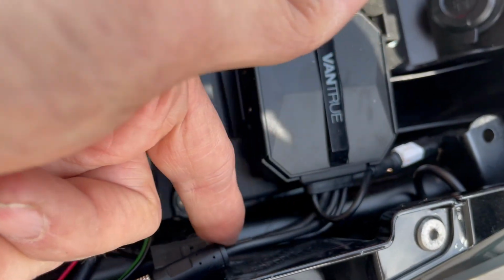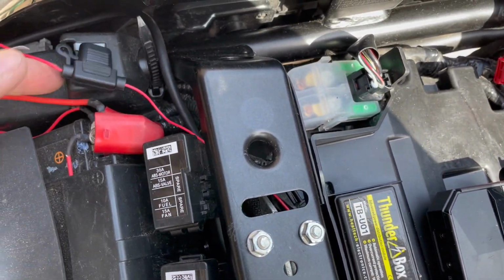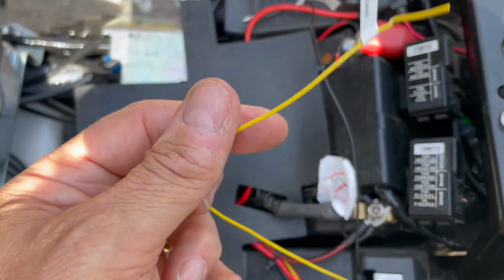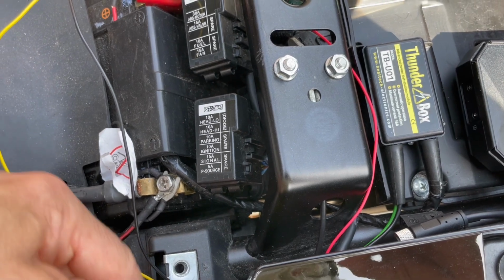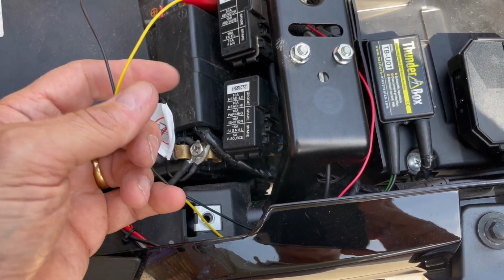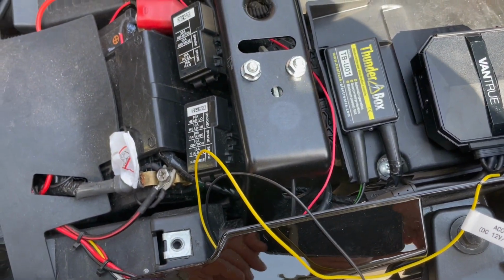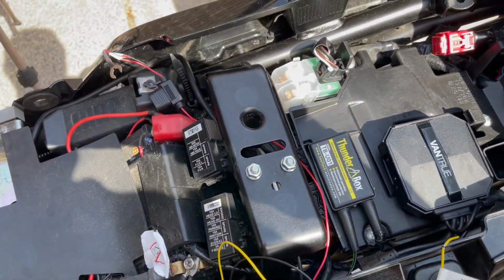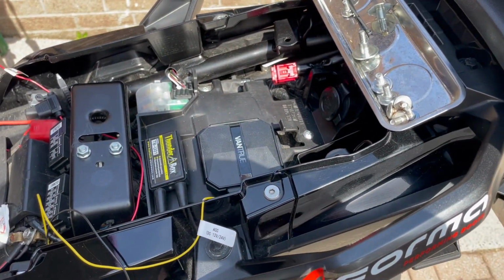And then the cables run down the side around the back here, and I've run the main live with the fuse in it, which will go into the live this side. I've got my ACC, my switched live, which will connect into my Thunderbox connections, which are down here, and I've got my ground that's going to go into here. So it's all very easy to connect now when I'm ready. But the next thing will be to put in the cables for the cameras. So I think rather than mount the cameras first, I'm going to feed the cable through.